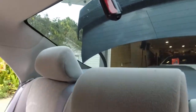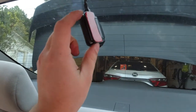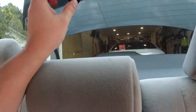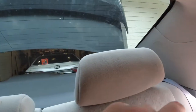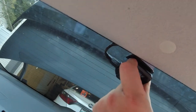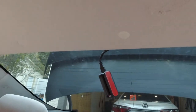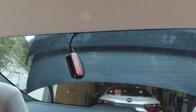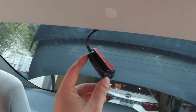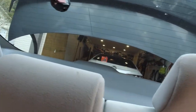I got the cable ran all the way to the back and everything is looking pretty good. I'm about to tape it to the rear windshield. One thing I did notice: I ran the wire on the driver's side, but the way to mount this camera, it's going to be on the passenger side — so it kind of has to make a hard bend. Kind of dumb, I didn't realize that until after I got all the way through. Keep that in mind when you install this yourself — it might be easier to run it on the passenger side because the plug is on that side.